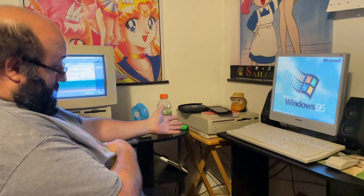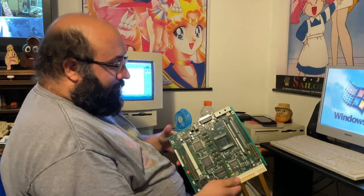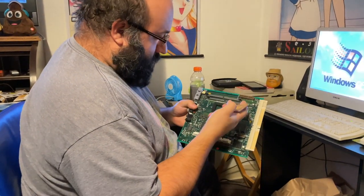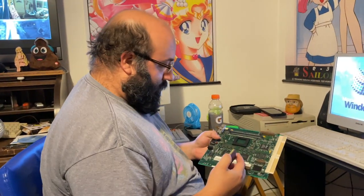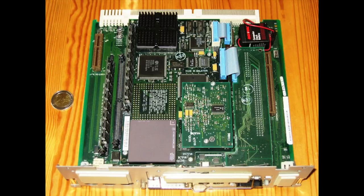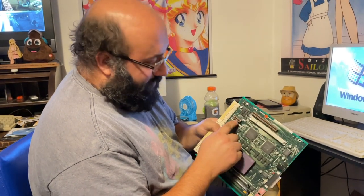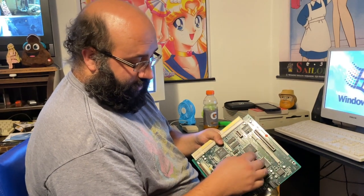One of the interesting things about this machine and the way it works — on the logic board, which looks like this, this is where the processor goes, which is this guy. He sits on here like so, and that's how it hooks into the board. Well, on this computer, instead of this being in there, there is a big piece that sits on top of this, and it has this chip in it — and then the PC's 486 chip in it. And here you can see — it's hard to read — but this is like a video output, so this is hooked to the PC board. And this is the processor direct slot, which interfaces with the logic board as well.